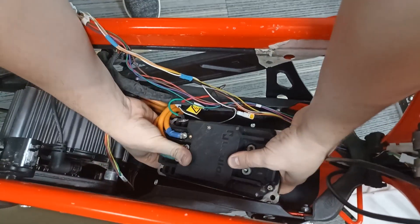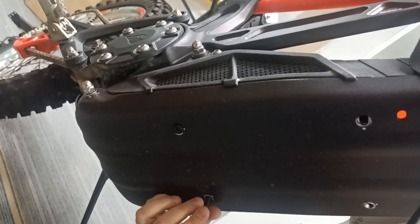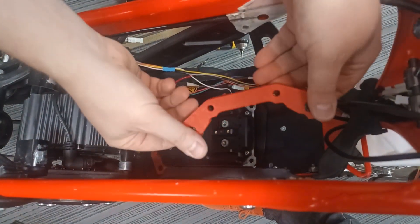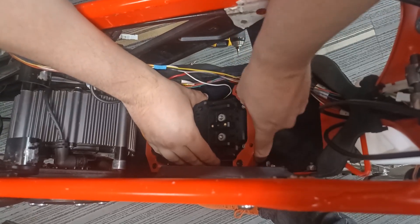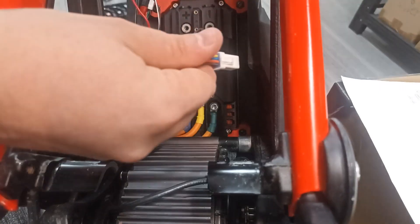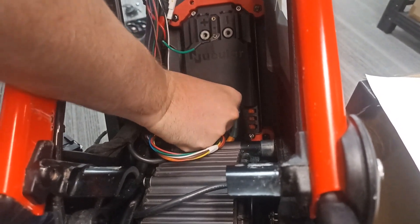Remove the soft material we placed at the bottom for avoiding scratches. Put the bottom plastic controller mounting piece and use it to secure the controller at the bottom without tightening the screws completely — phase wires are rigid and can get in the way. Install the top plastic controller mounting piece. Once all four mounting screws are in place, you can tighten them. Plug all the low current connectors into the controller according to the instructions — be careful not to confuse the plugs, as when the controller is installed it's difficult to unplug them.